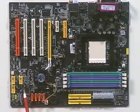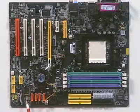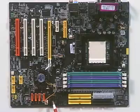We also have our BIOS and CMOS chip right here. Now on older systems, these were 2 separate chips. We had our BIOS chip and our CMOS chip. On a modern system such as this, they're all combined into a single chip. We also have our battery over here that powers our CMOS, to make sure we don't lose our settings that we configure.